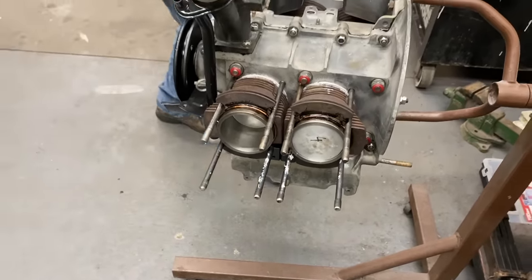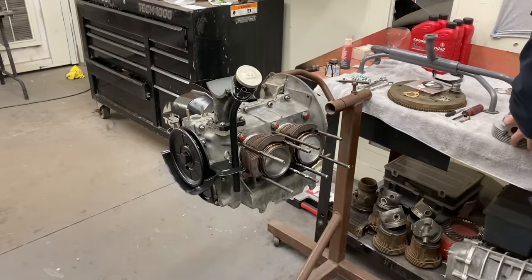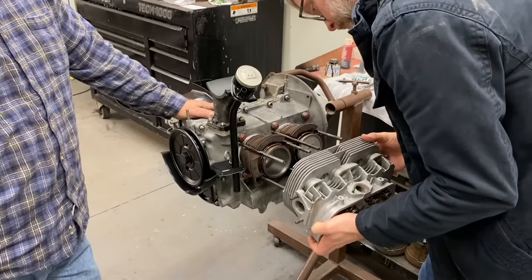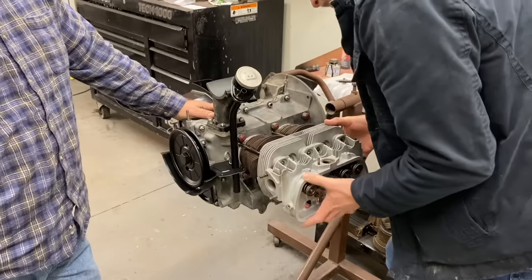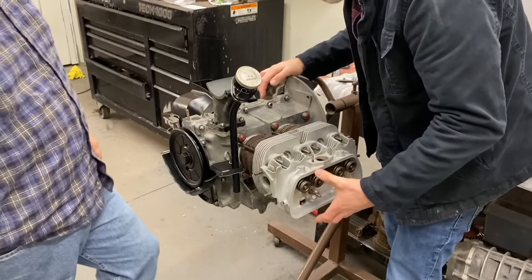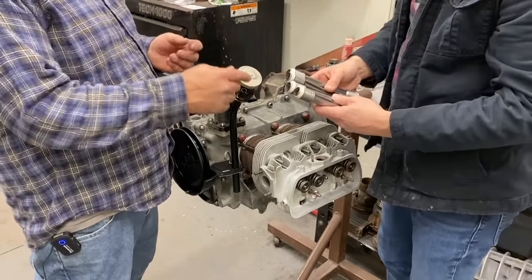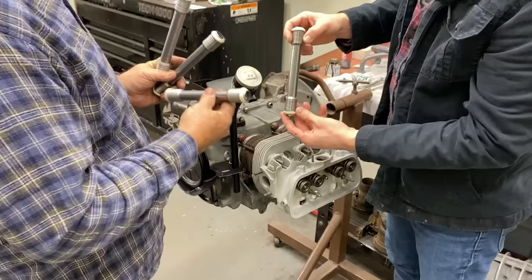All right, now you're ready to go ahead and put the head up there. All right, get the head on. Yep. Awesome. That's how it goes. Pop it on there. Beautiful thing. All right. Go ahead and push it up a little further. Okay. All right. Now we need the push rod tubes behind you. So that's it right there. All right. Seams always go up on these. You have where it's laser welded there. Yep. You want those at the top.